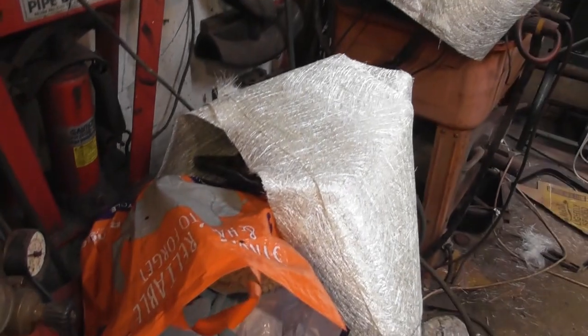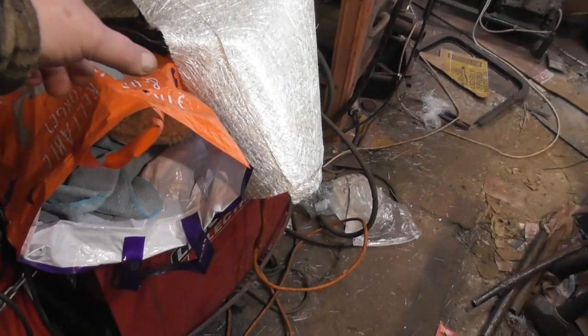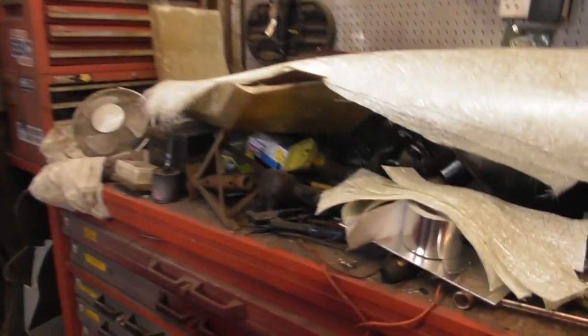All my matting is cut, ready to go on. First procedure, that's the first layup. So we go in across there, and we go in across there. Smaller pieces go on the sides. Second row, that row, then goes in all the way up. And then the third row, that one, they go straight in the middle. And then the off cut, which is tucked away under there, I chop that all up to build the sides up.